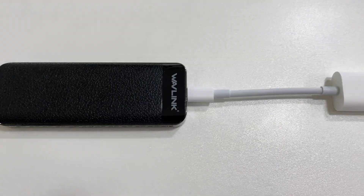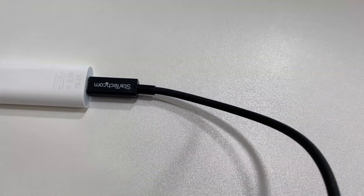I also thought it would be nice to use this drive with my 2013 Mac Pro. Whilst the Mac Pro does have Thunderbolt, it's the slower version 2, which also has a different connector type — but no matter, I've got the Apple Thunderbolt 3 to Thunderbolt 2 adapter. I connected it up along with a Thunderbolt 2 cable, and got nothing at all. I also tried a StarTech adapter and it was exactly the same. It turns out neither of these adapters pass power through, and the SSD drive is not self-powered, so of course it needs power on the Thunderbolt connection. So unless someone has come up with an adapter solution that can supply power, I won't be using this drive with the 2013 Mac Pro, which is a bit of a disappointment.